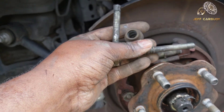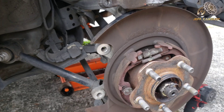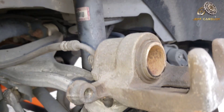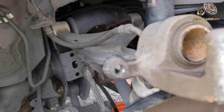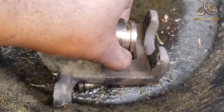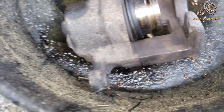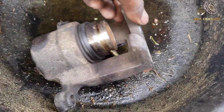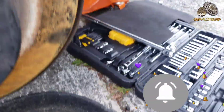Before I made my conclusion, I found another issue: the brake caliper piston would not collapse. I tried all my tools to retract and compress it, but nothing worked — none of the tricks. So I concluded that was the main issue, because every time he hit the brakes the caliper piston would come out but wouldn't retract back, leaving the brakes holding against the tire and causing the heat and noise.